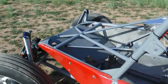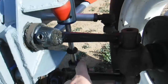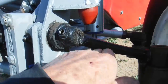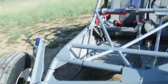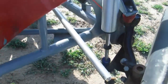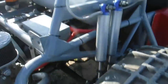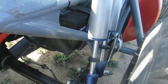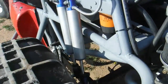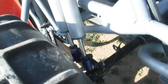Let's look at the suspension. What I did — they have these little rubber stops, and I pushed them all the way up so you can see how much of the shock I'm using on the front. Little tattletales. This side doesn't look like it moved as far — of course there's a fat guy sitting on that other side of the car. Oh, that looks like we're about half of the suspension. This one looks like it went a little further, besides where the fat guy was, the fat old man.